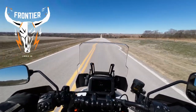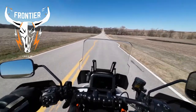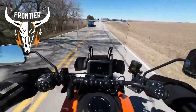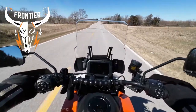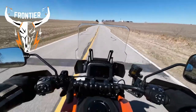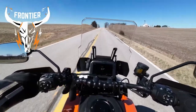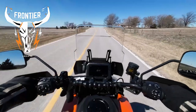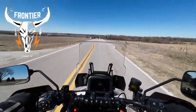I've got gravel here but it shouldn't matter for the Pan America. At 6,000 RPM, man, that's where it just takes off. So if you're doing 55 in a 55 speed limit zone and you're in 6th gear, you're around 3,100 to 3,200 RPM. When you lay into it, it takes a bit. But if you stay in 5th at 55 — this is all in sport mode by the way — that's a lot better, a lot more responsive. You might want to leave it in 5th instead of 6th for passing power.